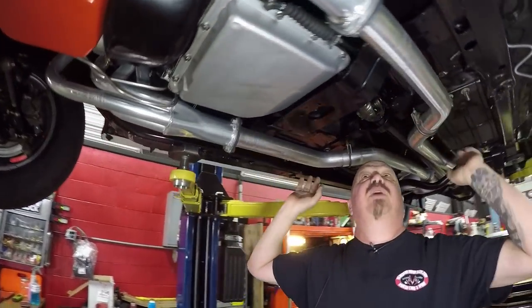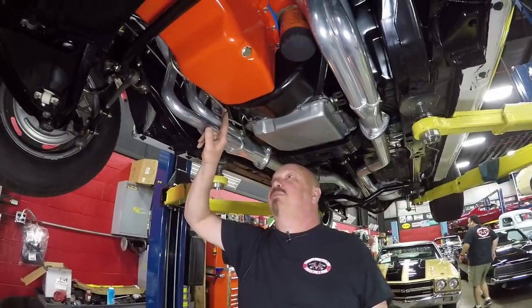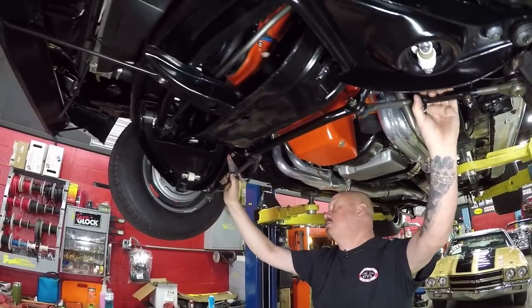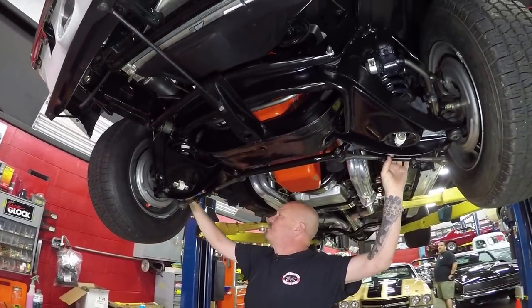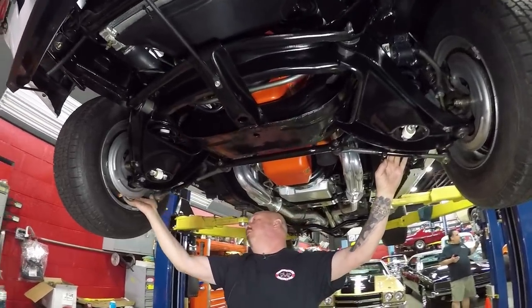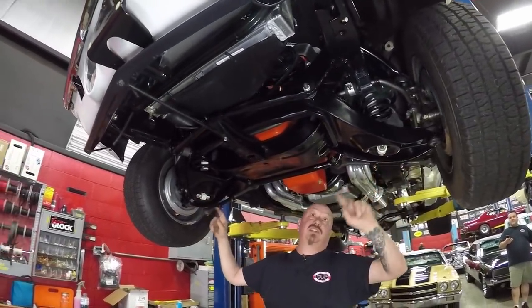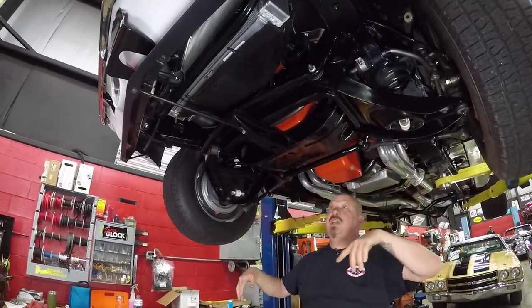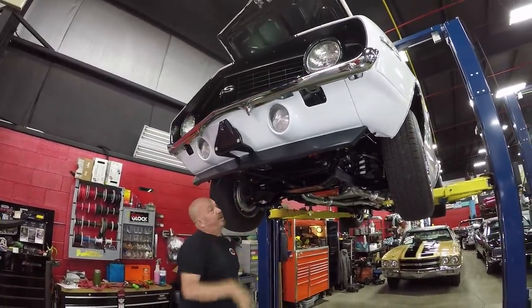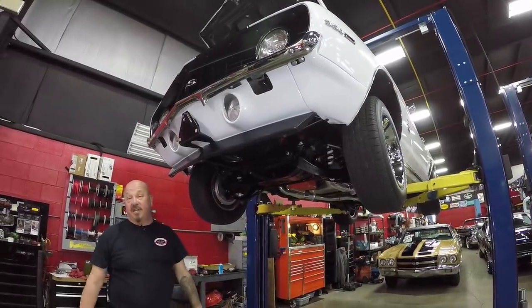The exhaust here is brand new. We do have a Turbo 350 trans — it's a three-speed automatic. Looks like brand new trans lines, looks like a high torque starter here. All the front suspension looks brand new, all the nuts and bolts look brand new. We've got looks like SSBC disc brakes up front. Rotors look like they're new — they feel slotted. Looks like new shocks, new bushings, new springs, new ball joints, cross members nice and tight. Core support — always look at the core support on these cars, it's one of the first things to go. Front frame horns are nice and straight. Just an amazing car.